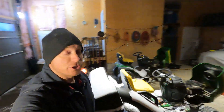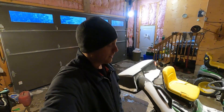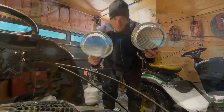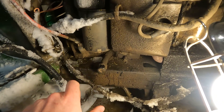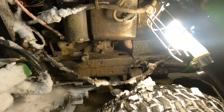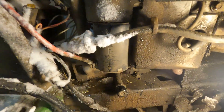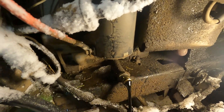So the last time I did this, somebody had the genius idea of getting a piece of tin foil and slipping it kind of under the oil filter so that when you're draining it, you don't end up with all that slop all over the frame of the tractor. So maybe we'll do that - we got some pie plates, let's try that. This is our drain plug here on this John Deere L120 lawn tractor - it's just a plastic cap. Give it a quarter turn and pull it out, and that's all there is. There's an O-ring in there that makes the seal to stop the oil from leaking out. It's a little bit Mickey Mouse in my opinion, but it seems to hold the oil in there between oil changes. So who am I to argue?